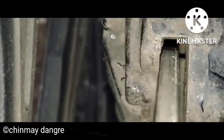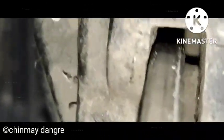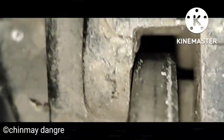This happens because of fork manufacturing or caliper manufacturing error. There is also one possibility — if you have used duplicate pads. The rotor is very much off-center, and because of the scratching the caliper is already worn out. This problem can happen in any motorcycle or scooter. Generally rotors are slightly bent — they are not exactly plain — so because of that you cannot fully control the off-center issue. It has to be in center for tolerance purposes.